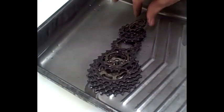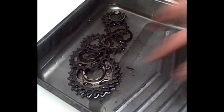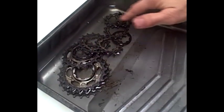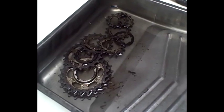Once you have the cassette off and all the cassette pieces free, all I'd like to do is put it in a little basin of solvent. I've used everything from mineral spirits to paint thinner — anything that's going to remove that grease. Remember, there's no bearings in the cassette, so you don't really have to worry about drying anything out too much.